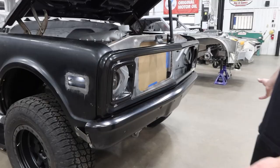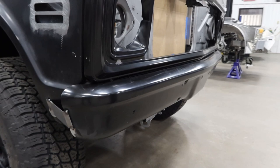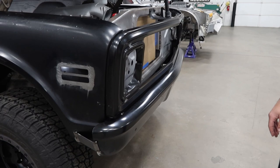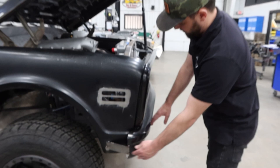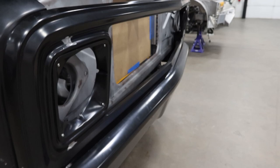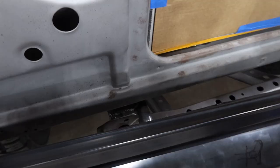If you followed it, you know we clipped it with a Tacoma clip, so obviously stock bumper brackets won't work. And in addition to that, we always cut up and tuck the bumpers anyways. So scratch building bumper brackets — what he did is basically position the bumper real nice and tight, centered it good, just tack these brackets in place. That just holds it where he wants, then allows him to come in to the frame horns and start scratch building the bumper brackets. We will be shaving the hardware so it'll be totally smooth — the brackets will be welded inside the bumper.